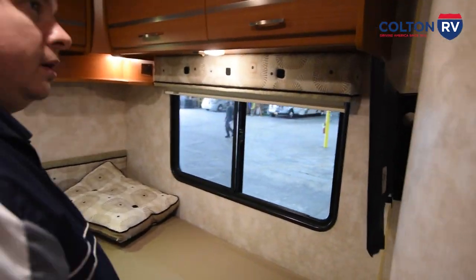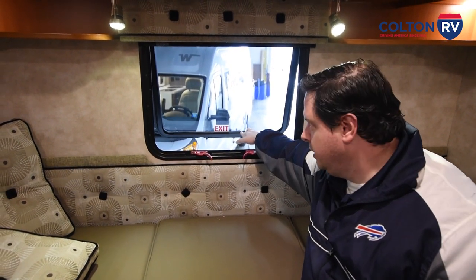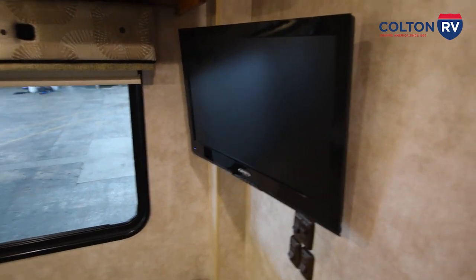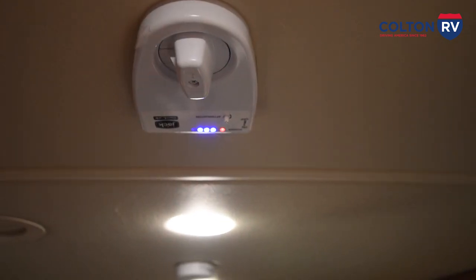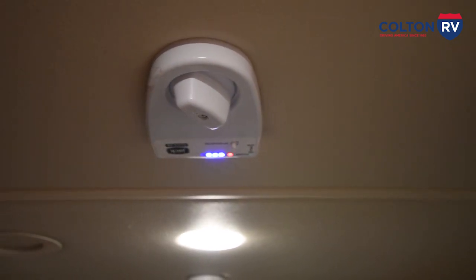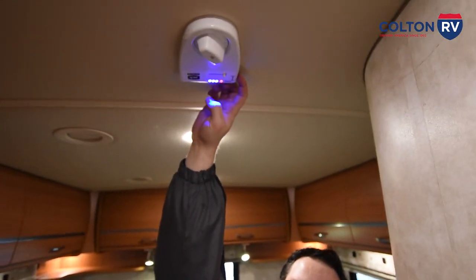Lastly in your bedroom, in the back I just want to show you your emergency exit. It's hinged — all you do is unhook this, and if you ever need to get out in a hurry, there is your escape route. Leaving the bedroom on the side, you have lights here, and then you've got another TV. On the ceiling, your antenna on the roof is directional — you don't have to crank it up and down. This one just rotates. If you need to find a better signal, you can rotate this until you're locked in on a TV signal. There is also a gain on it — if you need to turn it up, you can so it tries to pull in a better signal. You can shut off the antenna here as well as in the closet up front.